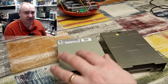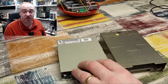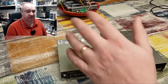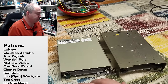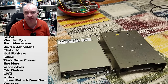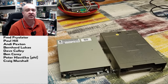As I said earlier, it has been manually aligned, and while it does work — I've actually further tested this drive off camera, put it in my 1200 in position DF0, and ran a few games from there and they all worked fine — I couldn't with any authority say it's 100% aligned correctly, because to do so you really need the proper alignment diskette hooked up to an oscilloscope. But it is working to the point where it seems to read any disk I throw at it, and surely that's good enough for playing a few old games. So that's going to be it for this video — hopefully you enjoyed what you've seen. If you did, I'd appreciate a thumbs up, hit subscribe if you haven't already, and I'll see you next time.